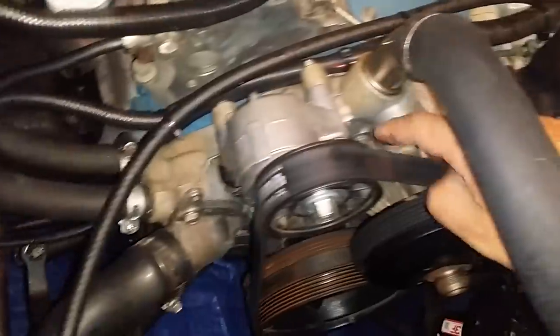On the new radiators, I don't know if they universalized stuff, but if you look, there's your upper transmission cooler connector. There's a boss right here with an eighth-inch national pipe thread fitting. You can just put a little nipple in there and a nice little bypass — you're not tapping into the water pump like I've seen some people do. You're just simply hooking it up.